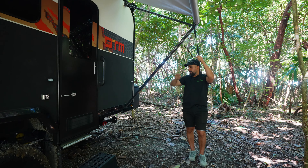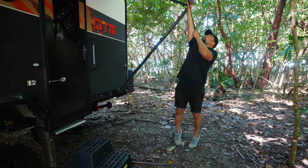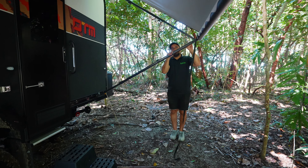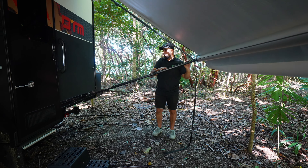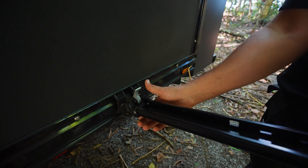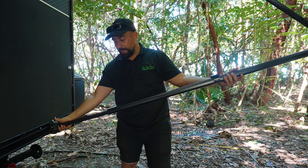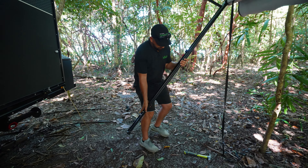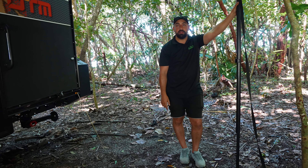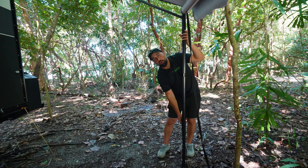The third way is completely releasing the legs off your awning. Re-flick the lever into the open position, come to the bottom of your awning leg — there is a latch you can lift up to release. Make sure you've got a good grip on your awning arm. Once down, always peg your awning arm to the ground first, and then you can adjust your height.